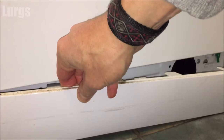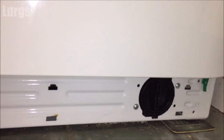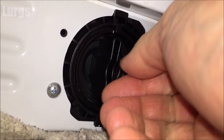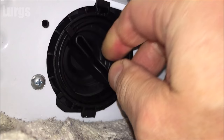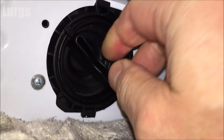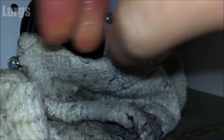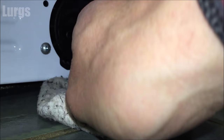This is the filter here, which is on the pump. To remove this you just turn it anti-clockwise, but make sure you get a couple of decent-sized cloths on the floor because it will spill water everywhere — and it will smell, trust me. You shouldn't get tons of water but enough to need a cloth down there. Just let it drain off, squeeze the cloth out into the sink, and then put the cloth back down.